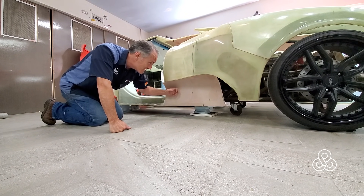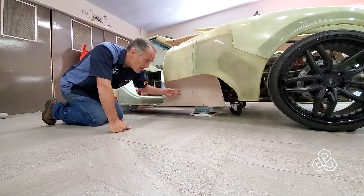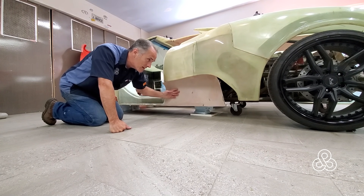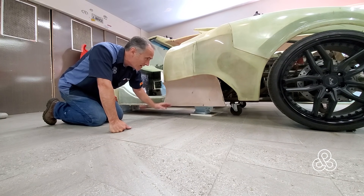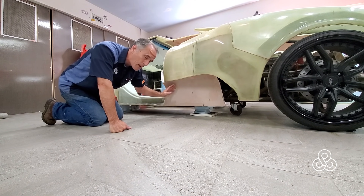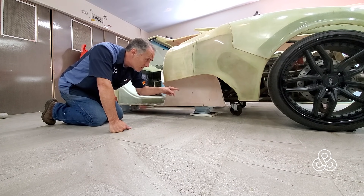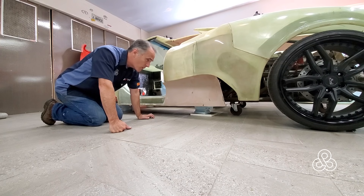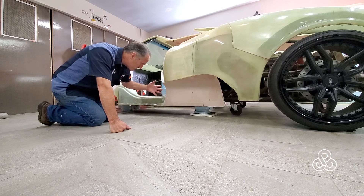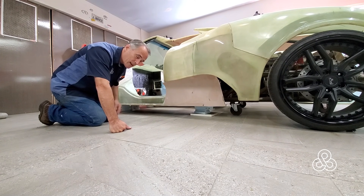We're going to get down here nice and low to see this part. If you've watched the fabrication videos for this area, this was all done with the car upside down, most of it. That's one of the reasons why when I was working on creating the original plug to create the molds, I didn't finish this and I knew I could do it now. But in retrospect, after doing all the work here, I think I might have actually finished this in the plug and had this as part of the mold for the car. It would have been a little trickier — I would have had to have some different parting lines because of major undercuts — but I could have gotten a little better finish by fabricating the parts in the mold. And it's going to be the same thing with the door: once the door is put in here, we have to fabricate this in person rather than having it molded into the door itself.